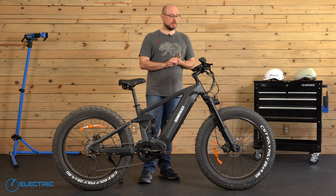To test every bike's hill climbing ability, we take them to a local hill called Hell Hole, which is a steep but paved path that's a third of a mile long with an average grade of 12%. This is a pretty serious challenge for most e-bikes, and some don't make it all the way to the top. We do this test both in the max pedal assist setting and with just the throttle. This test is really where the torque and power of the Cobra Pro came to the forefront. With only its throttle, that 1,000-watt motor sprinted to the top in just one minute and one second with an average speed of 17.8 miles per hour. In Sport mode and PAS 5, we pedaled up in one minute and two seconds with an average speed of 17.5 miles per hour. These results are crazy fast and prove that the Cobra Pro can handle even extreme uphill climbs without really breaking a sweat. At this time we've only tested two other e-bikes that have exceeded the Cobra Pro's performance, and even then just by a few seconds.